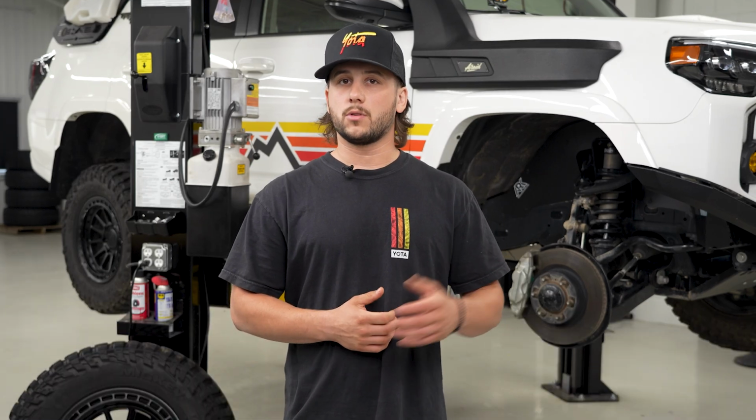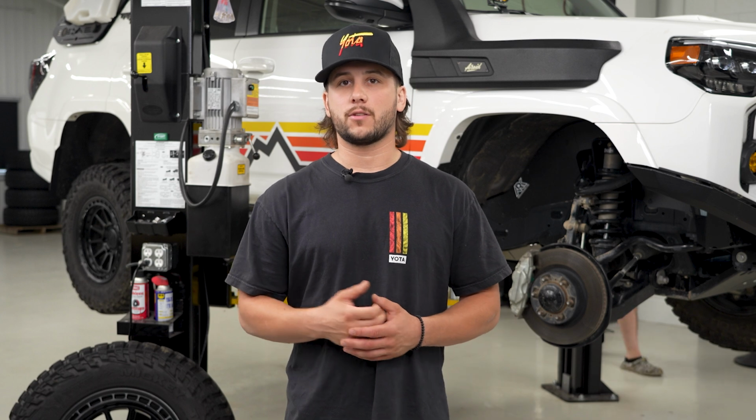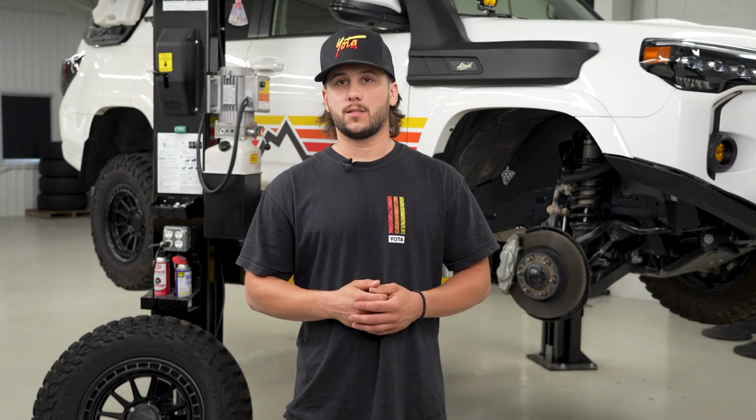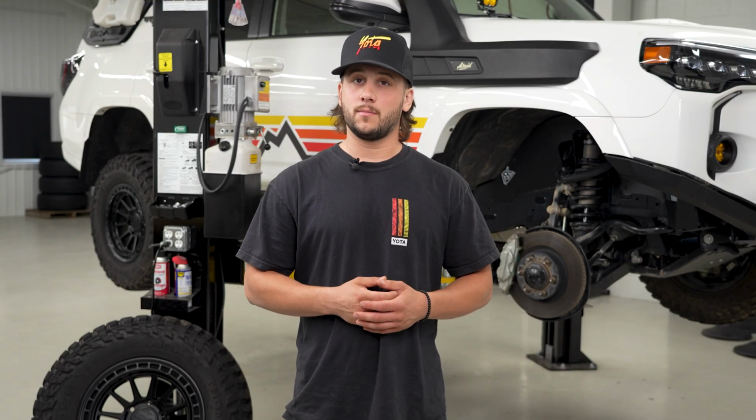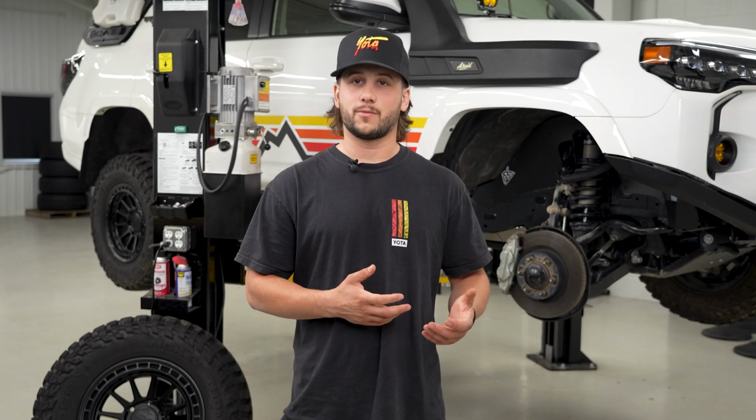So those are the top 5 beginner mistakes when installing a lift kit. Just make sure that you do your research, budget for the extra parts, plan ahead, check for extra weight, check your hardware and torque specs, and do not skip the alignment. If you avoid these mistakes, you'll save yourself a lot of time, money, and frustration, and you'll actually enjoy your lift instead of regretting it.